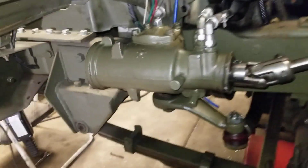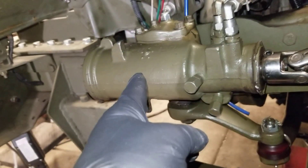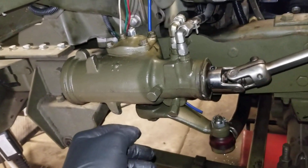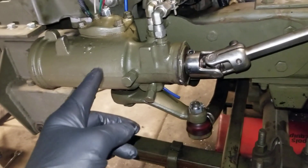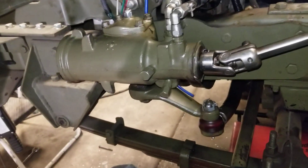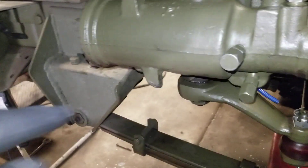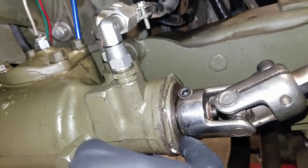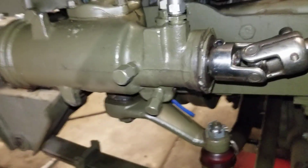Hi guys. I've had a nagging leak in this steering gearbox — I put this in about six years ago when I built this truck. It came straight from the junkyard. This is a Saginaw box, not sure exactly which one — an 800, 780, or 880. They had these in Chevys and Dodges, back from the late 70s to mid 80s. I had this nagging oil leak down here on my sector shaft and pitman arm, and also here on the input seal. Started out as a weep and then it just started dripping, and I got tired of the mess wiping all the scum off my undercarriage.